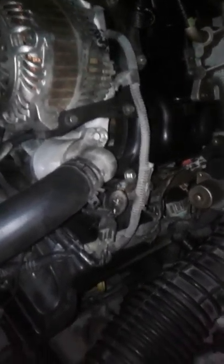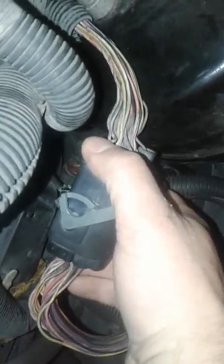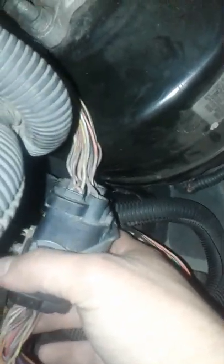I recommend just checking out your wiring harness — get another one and replace the whole thing. To trace down exactly which wire is causing the problem, you don't know where to start. I figured out mine was obviously in the connection right here, because when I would bend the wires it would start and sometimes run better. But I said you know what, I don't feel like pulling individual wires out — I just replaced the whole harness and it works great.